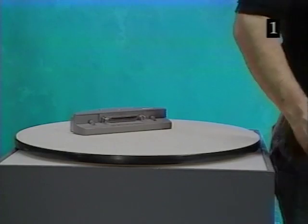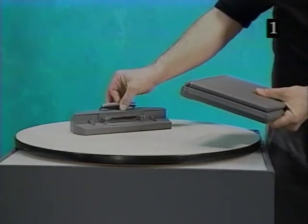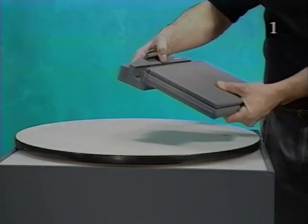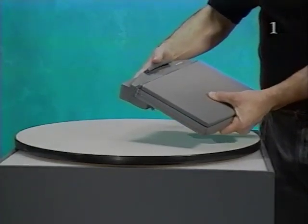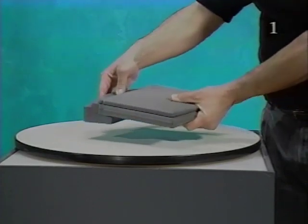Here's how the Duo PowerBook attaches to the mini dock. Pull up on the latch at the top of the Duo mini dock. Slide the posts on the mini dock into the corresponding holes on the back of the PowerBook and gently push the 2 devices together. Push down on the latch at the top of the mini dock to secure the connection.